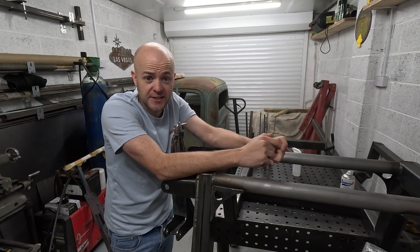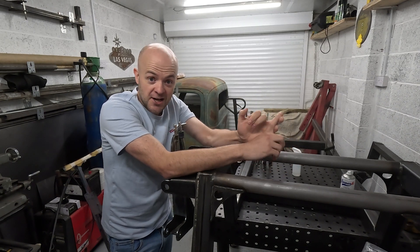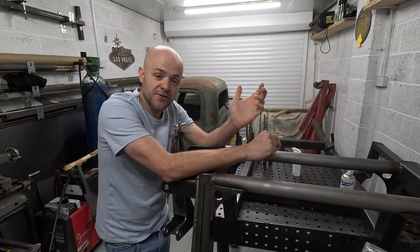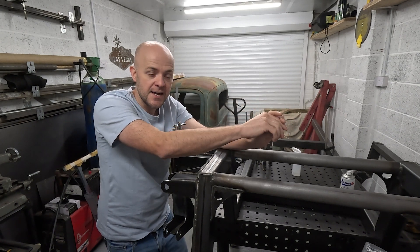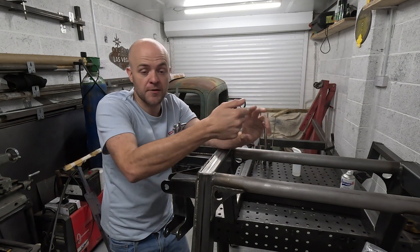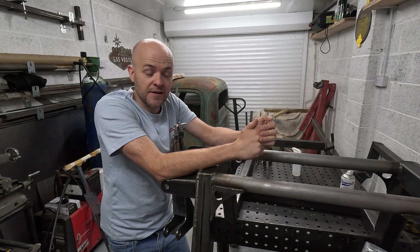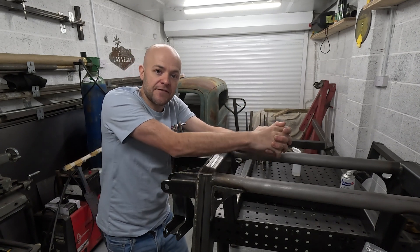It's dead simple. Those are the only things you need to address: your power steering, your alternator charging wire, and just override your ignition — that's all you need to do. The only other thing is you're not going to be using the A1 fuel pump relay, so you can take that out and wire the fuel pump relay from the Fabia side to the wire going to the fuel pump in the relay section. I just take the relay backs out, connect into the back of the bay, and don't bother putting the A1 relays back in. But yeah, let's go and have a look at the car and I'll show you the gauges that work.